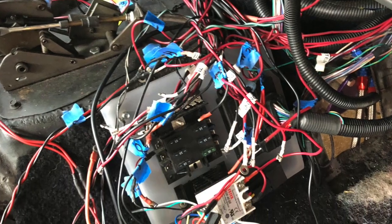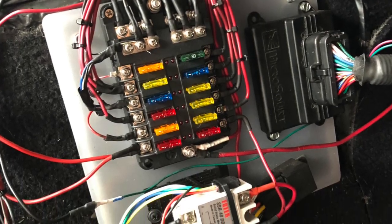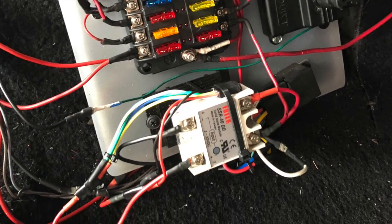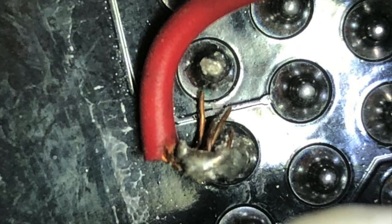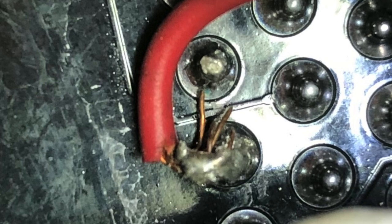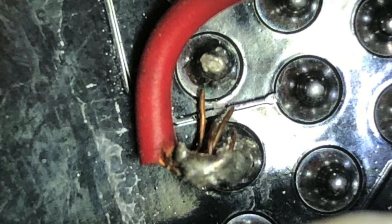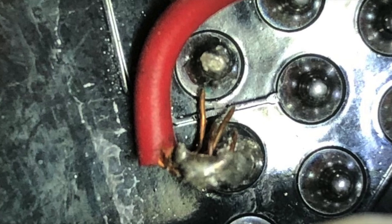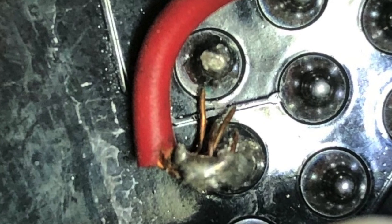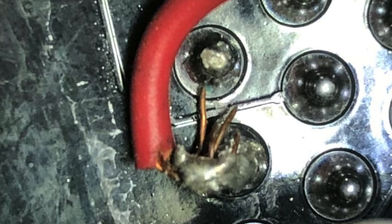I still get people horrified at the wiring in the car, but I did do some cleanup to it over the winter as well. I put a new fuse box in it. In doing so, I also discovered that due to my awesome soldering skills, I had a problem inside of the micro squirt where one of the wires would occasionally ground out against the second terminal and was causing a miss and would cause some weirdness in the log files — so I got that fixed as well.